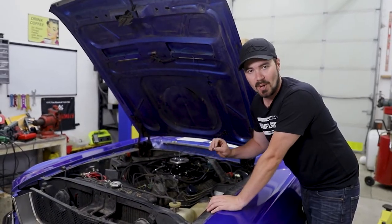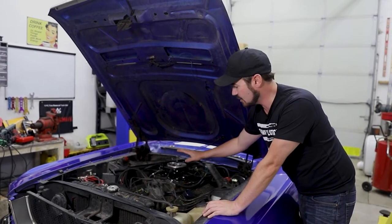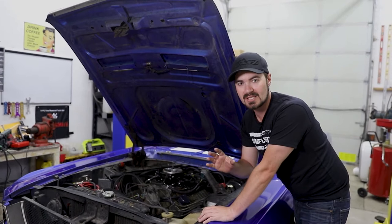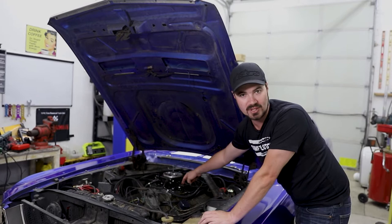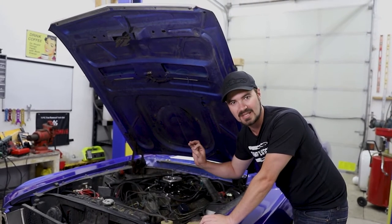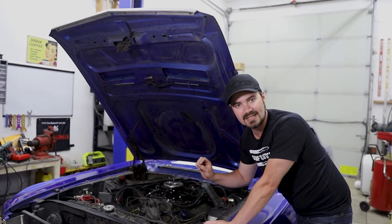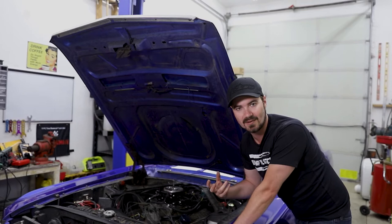The first issue, and probably the most annoying one I encountered during the installation, was attempting to get the unit to idle properly. When we first installed the unit, it would not idle below 2000 RPM and every time I would try to adjust the screw to control idle, which prescribes an initial break to the throttle plate keeping it open at all times, the idle would go bonkers. That was because the IACV, the idle air control valve, was attempting to fight me in this reset of the system.